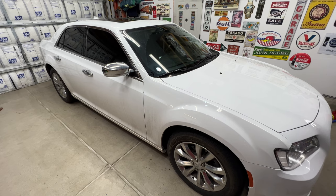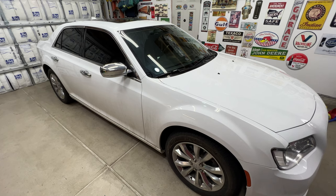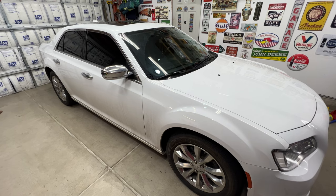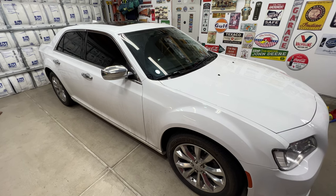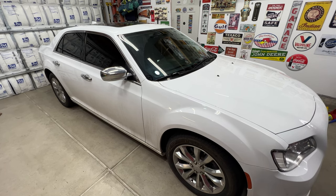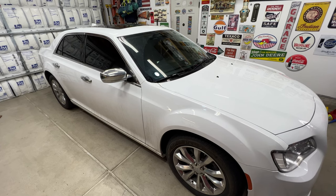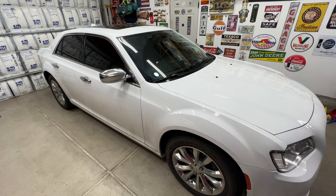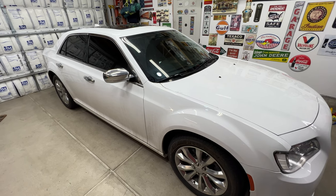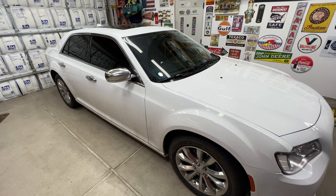Alright, so that's going to do it for the video. This was a 2016 Chrysler 300 3.6 liter — went ahead and drained the cooling system, replaced the thermostat and housing, along with the coolant pipe, and upgraded both to the aluminum style ones, so hopefully my daughter has no more issues. Then of course refilled the cooling system with new coolant and bled it. I'm going to check this coolant level in the morning once it cools off because the level will drop a little bit and then I'll top it off to the max line. Hopefully this video helps you out — if it does, why don't you subscribe to my channel, check out my other videos, I got a bunch on this car alone. See you next time, thanks for watching.